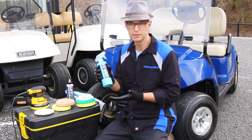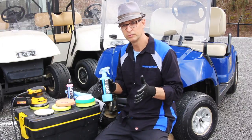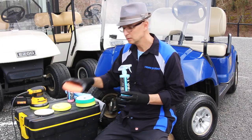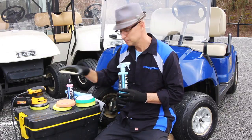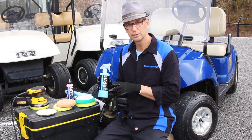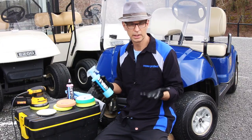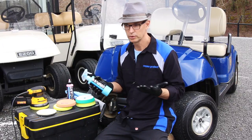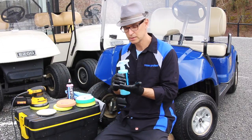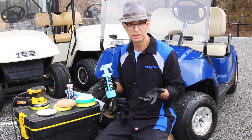You can actually use this to buff onto a cart as a final finish, or for a cart that is in good shape — use a polishing pad or microfiber pad and use this as a fine finish polish or for regular cleaning. If you've got a new fleet of carts for a club, you don't require machine buffing. This and RenewProtect Black, Satin, or Gloss is all you will need, and you can maintain that cart infinitely in as-new condition.